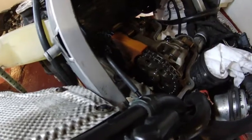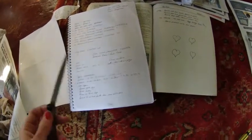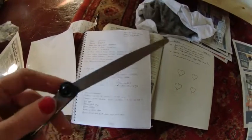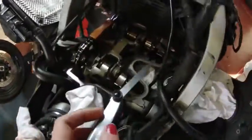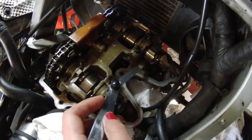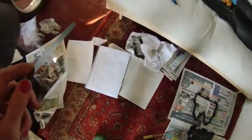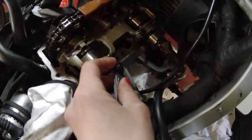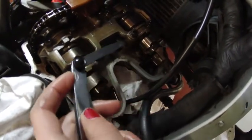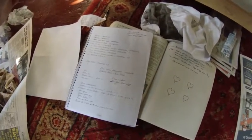The lines are now matching up, and you also want to make sure that the holes in the sprocket are at the top. Now I'm going to check the exhaust valves — the range here is 0.25 to 0.33mm. I've got my 0.25 feeler gauge and I'll simply slide that underneath. Then I tried 0.25 plus 0.05 making 0.3, and the good news is that it doesn't want to go through on either of the exhaust valves, so we know it is between 0.25 and 0.33.